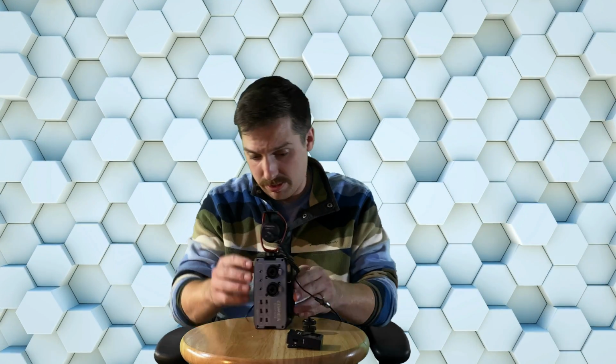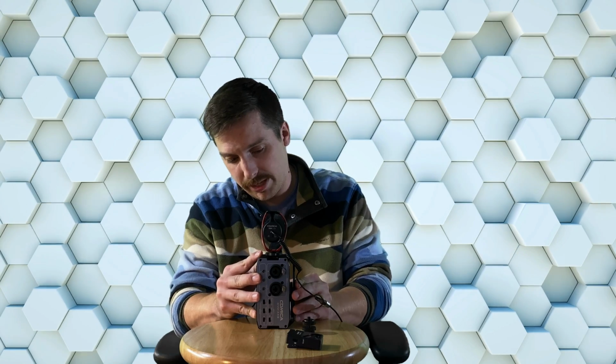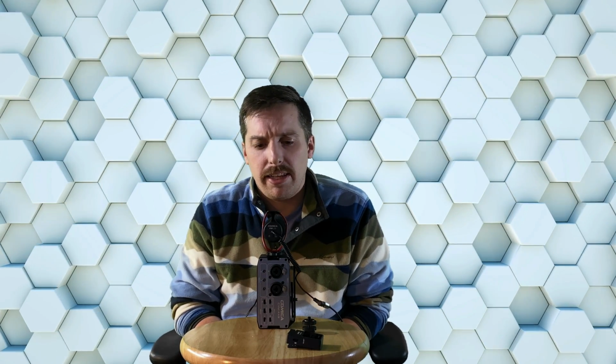Alright, I can't live monitor anymore because I don't have the AX3 hooked up. But you should be able to hear me now directly into the iPhone. And we're talking to the phone, but we have this still on camera mode. And the reason for that is that we have the TRS to TRRS adapter in line. If we take that out, we need to switch this back over to phone mode in order for it to work. So let's do that real quick too.